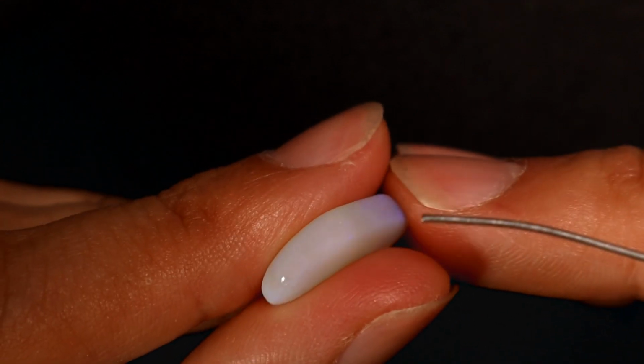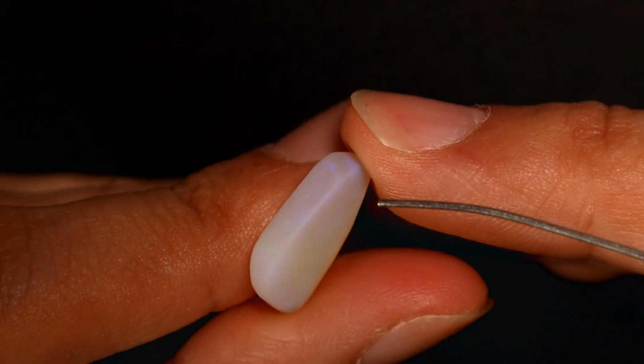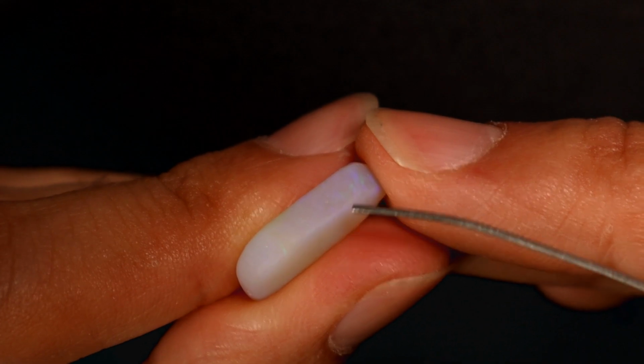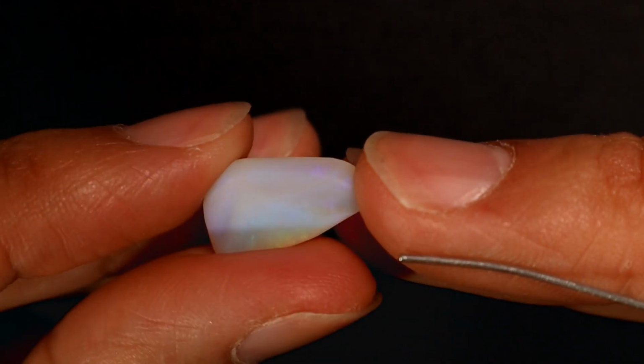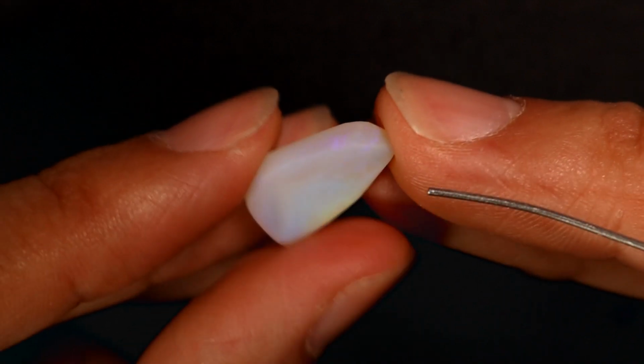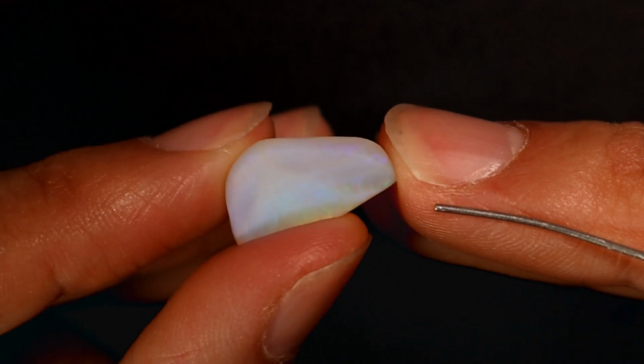But really, for that to be the only two tiny issues after a 280 grit Nova, that's not bad, and you can get rid of these with the 600 brown Nova, but I'm just going to fix them up just a tad with the black 280, and then I'll be back after we've gone through the 600, so you can see what it's like at that stage.